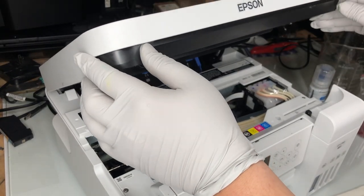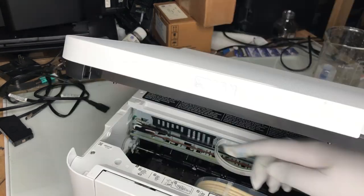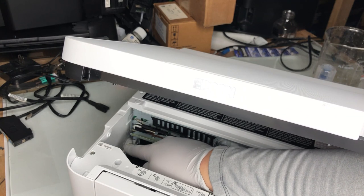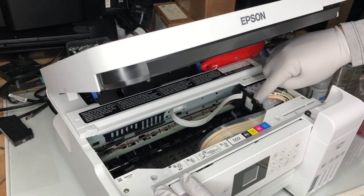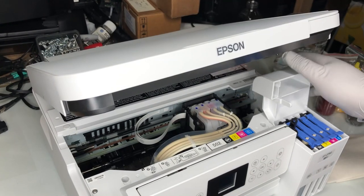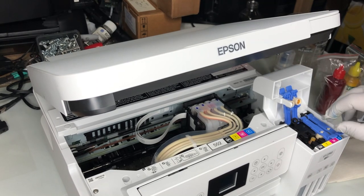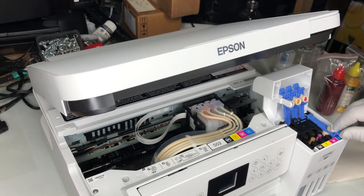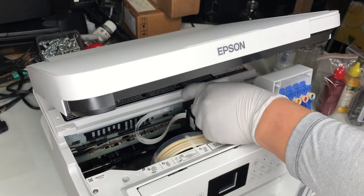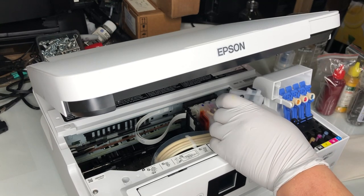Open the printer — you're going to find that the printer is locked. Move the printer to the right and then turn this wheel counterclockwise. Do it three times and then you can free the printer. Open that. We're going to suck ink out of the printer's damper. Every time we suck ink, we need to make sure those levers are open. The dampers are pretty easy to remove — just put a tab in and lift it up.